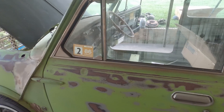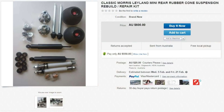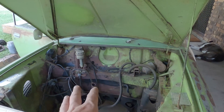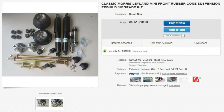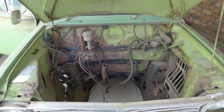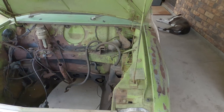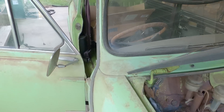Even if it's not perfect, we still want to get it on the road and get it to drive around and be safe. I've ordered kits for the rear subframe — I'm going to completely rebuild that: new brake drums, new hubs, new bearings, shock absorbers, all the suspension, all the cones and everything will get swapped out. Similarly with the front, we'll add a seven and a half inch disc brake front end and replace everything. The steering rack I'm not sure about — I know that's a real big thing to get out because you've got to drop the subframe. I may even have the front subframe re-powder coated when I have it all apart, just so the engine bay looks like a show piece. I plan on getting this car out and being a part of the community as best I can.